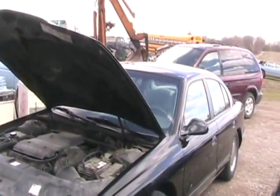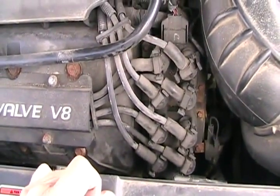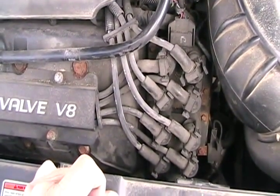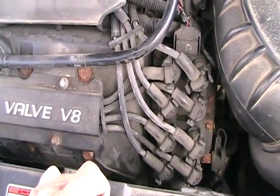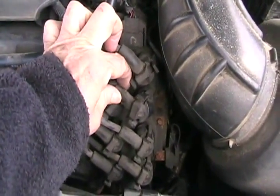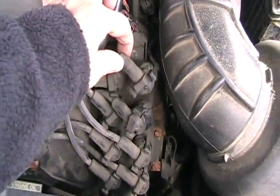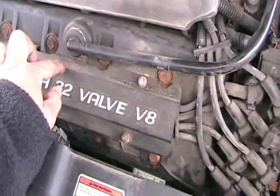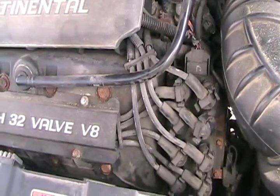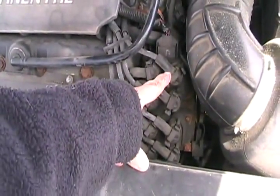So now we're going to diagnose why this car is misfiring on one cylinder. First thing I suspect is maybe the coil pack. Fords and their V6 and V8s have a particular problem with their coil packs going bad — minivans, cars like this, everything. I've loosened all the spark plug wires on one bank of the coil pack along this side. If you pull the wire off here, there's a better chance of not getting sparked and shocked than pulling the wire off from underneath. So whichever wire you pull off and the engine runs exactly the same, well that's the cylinder that's not firing.